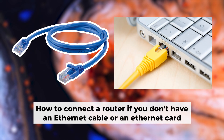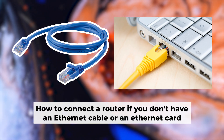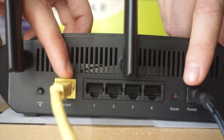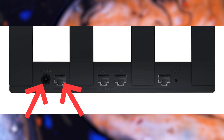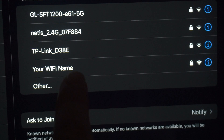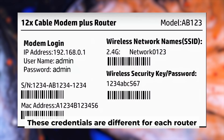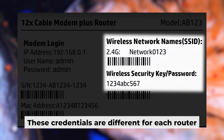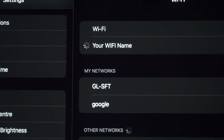Now you will need to set it up. But first, I'll show you another way to connect the router if you don't have an ethernet cable or your computer doesn't have an ethernet port. Connect the router to the power source and plug in the cable from your internet provider — this will enable Wi-Fi. If your router is new, your Wi-Fi network name will be the name of the router. Your router has its own Wi-Fi network name and password printed on a label. Connect to it. Great, you've connected to the router. Now let's start setting it up.